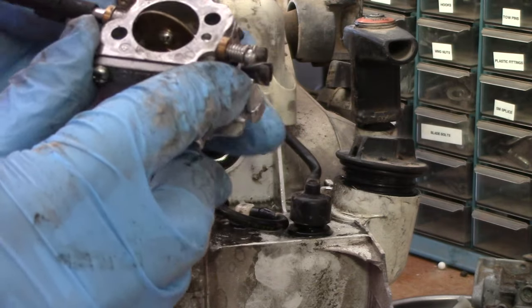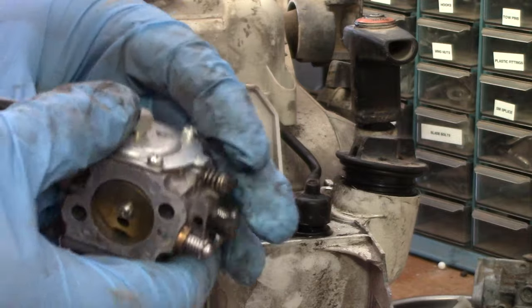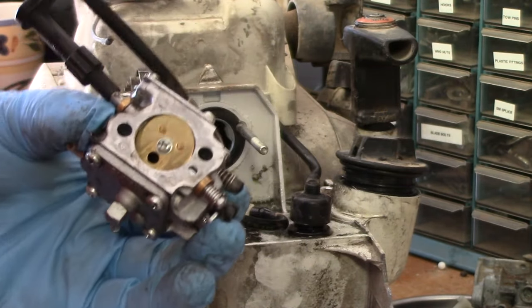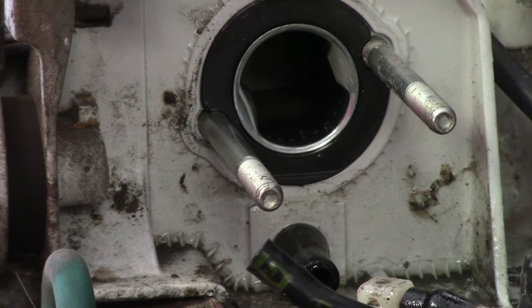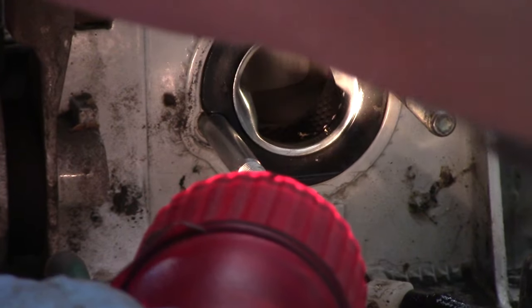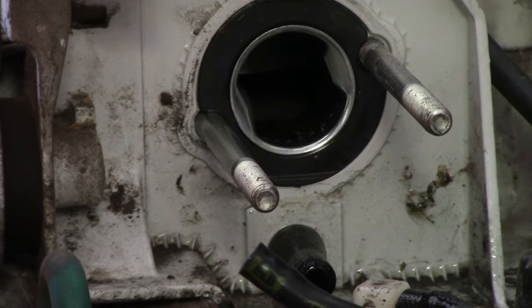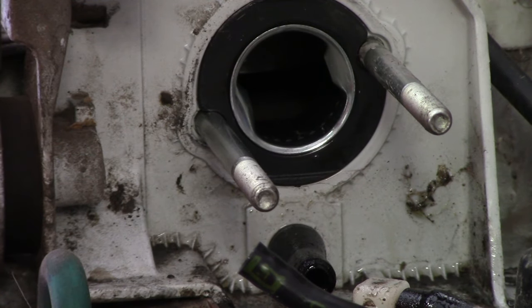The throat of the carburetor looks really clean inside, but that's only part of the battle because we have to remove both of these plates — there are gaskets and diaphragms under them. The owner did say this was hard to start, so I'm going to double check the condition of our piston. It looks to be in pretty good shape — really clean. I'm not seeing any grooves or imperfections on the side. The best way to confirm is a compression test, but nothing readily apparent.